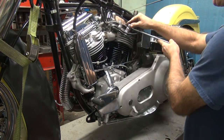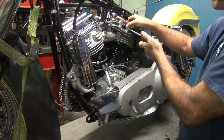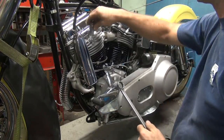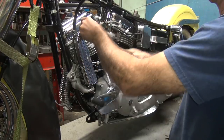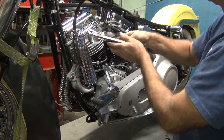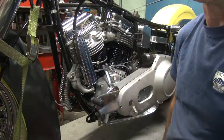So I tighten them up until they quit moving. Crush that spark plug washer, then I back it off, and I put a little torque back on it. Factory torque. And it still is loose after I run them.